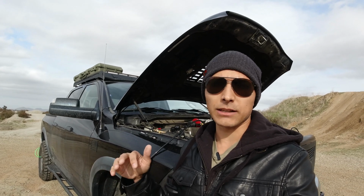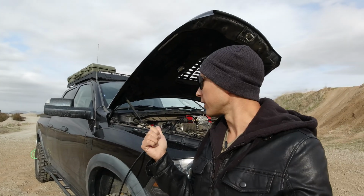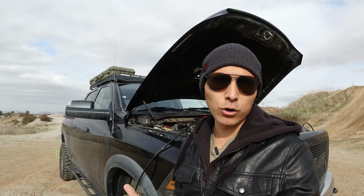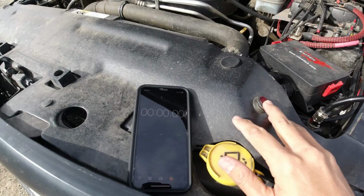So I'm going to go ahead and flip the valve for the tank here, and what that will do is allow excess pressure that does not go into the tires to go into the tank instead, so that way we're not pulsing our compressor on and off. It will, of course, add to our air up times. Now, in my experience timing this compressor, it takes about 1.5 minutes to fill up my air tank in the back. And so at most, it should be adding 1.5 minutes to our overall fill up times.